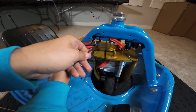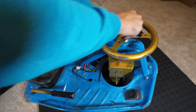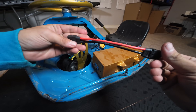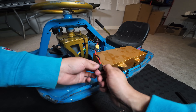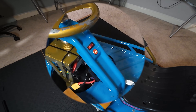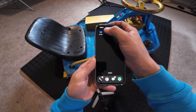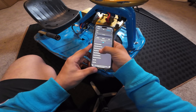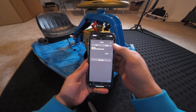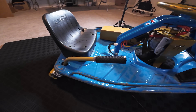I clipped off all the ends of the zip ties — finally done with cable management. I grabbed the steering wheel, put it into the fork, made sure it was tight, then turned the wheel to make sure nothing was catching. I grabbed my headset wrench and tightened down my headset. Now I grabbed my battery cable extension, plugged into the VESC, twisted it to remove some length, and then plugged it into the battery. Now it's time to see if it powers on. That's a good sign. Now because this is a brushless motor, I actually have to install the tune with the VESC app. I connected up to the cart and uploaded the tune, as well as detected the motor for hall sensors — a super important step that lets the motor know exactly what position it's in. I recalibrated my throttle to get the full range of motion. Seems like it's working. Let's go test it.